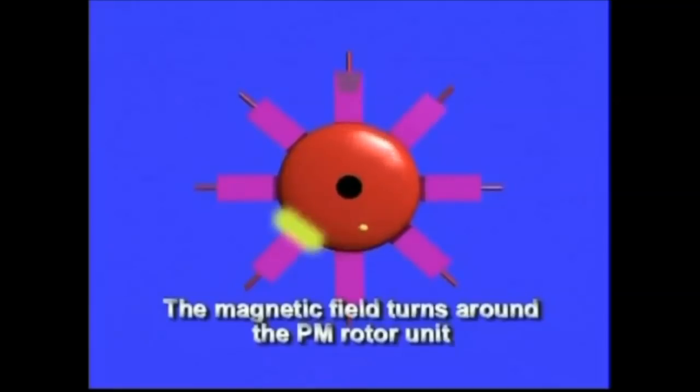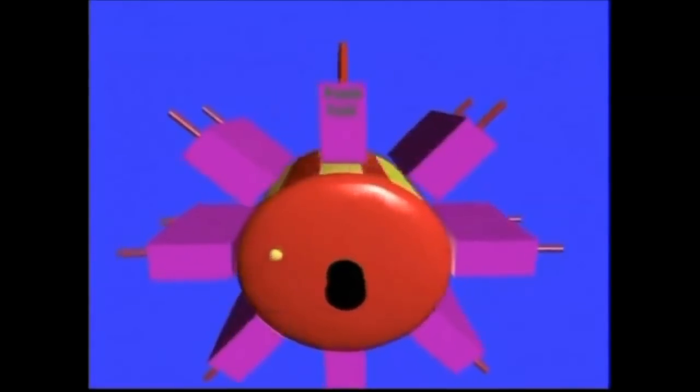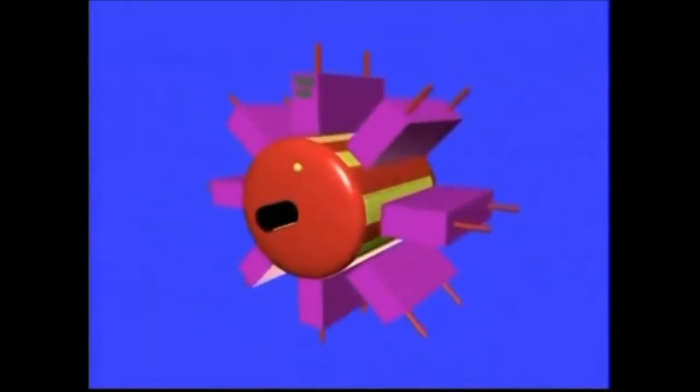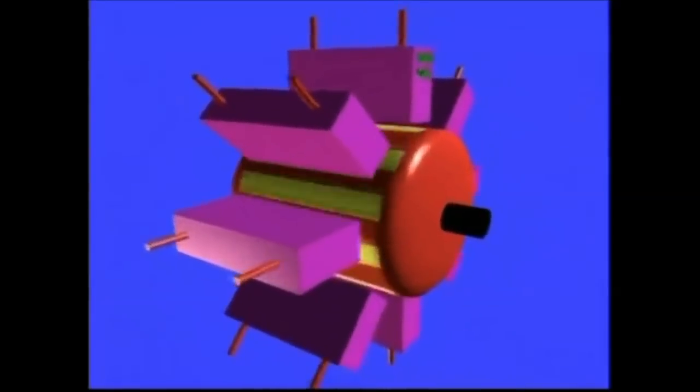The energizing is a little more complex than what you see on screen — sometimes two phases are energized at the same time — but you get the idea. That's why it's a three-phase motor: each phase actually feeds a group of different coils around the rotor of the motor. This is the system being used these days by pretty much everybody that has anything to do with hybrids or electric motors — whether it's Teslas, Toyota Priuses, Honda Insights, or any of the hybrid vehicles being manufactured, as well as the Fiat electric and the Nissan.